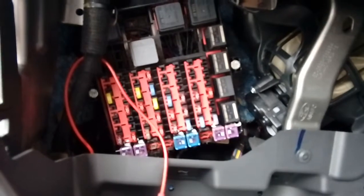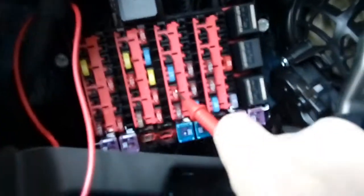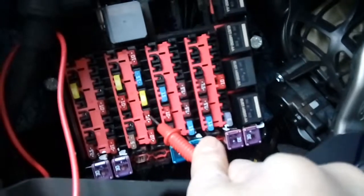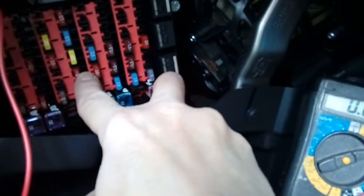Pop that back in, put the glove box down, and thread your power wire through towards the fuse box. Now we need to test the fuse box to see which fuse is ignition-switched. With the ignition off and the key out, get the test probe out. We're looking for a circuit that reads zero voltage — touch the top of the fuses. Zero with ignition off is good. Some fuses will be live all the time and will flatten your battery if you wire to those. Put the ignition on and test again — the same fuse now has voltage. This is an ideal fuse to use: an accessory position fuse. Don't use anything for airbags or the ECU.